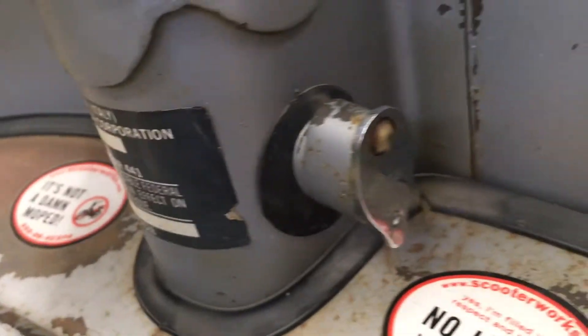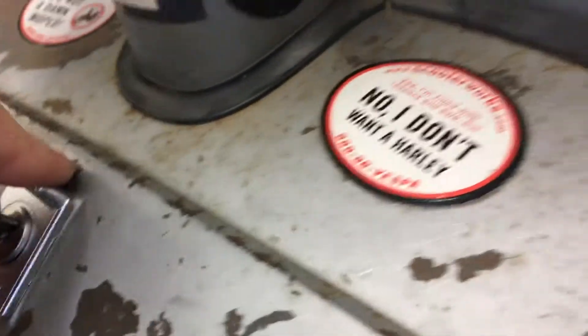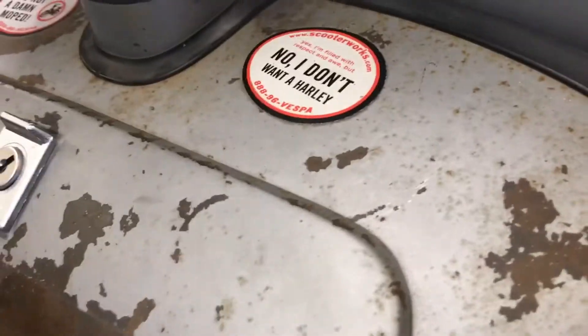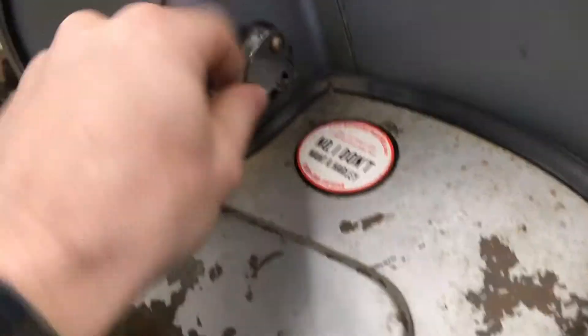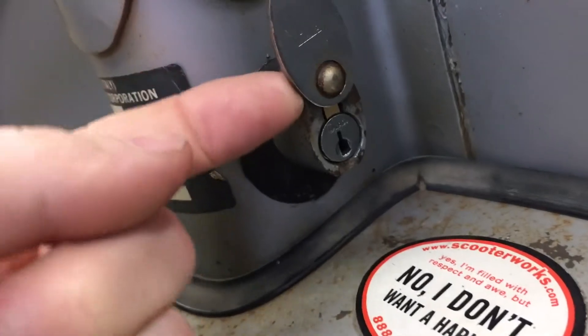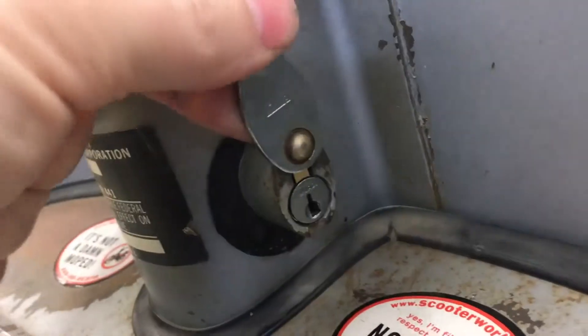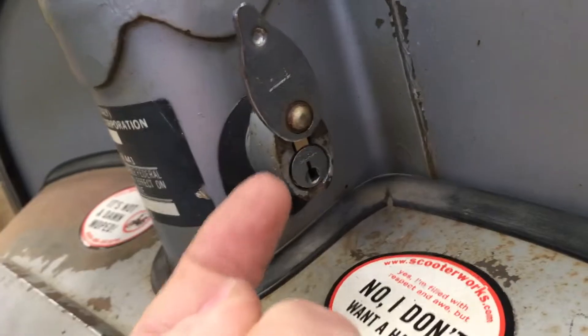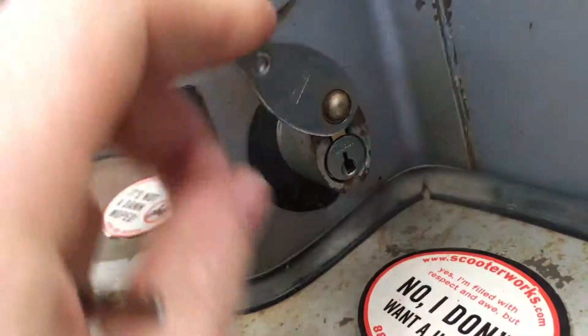The other shining good news was this glove box lock and column lock set. They're great. I've never had a lock on the glove box before, so sometimes it would just vibrate open while idling. Now I can park it at work and not worry about people going through here grabbing tools or running off with the scooter. A bit of advice if you want to replace this: the pin comes out, requiring pressure from the backside on the plate, which pulls the brass pin out. Then the lock cylinder — you'll either have to drill it out or pick it by twisting to the left and setting each pin. Pull the cylinder out, snap the new one in; that rivet holds it in. It took about ten minutes and I now have a key for both locks.